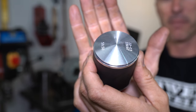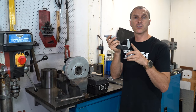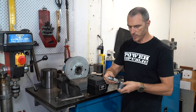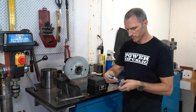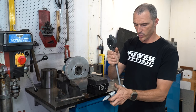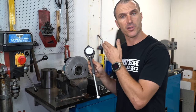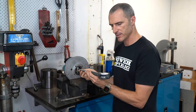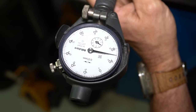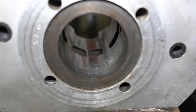The brand new piston is ready to rock and roll. We're going to measure it using the outside micrometer — you can buy a cheap one online, it'll probably do the same job as a fancy one. Just want to measure your piston carefully. Then you can set the bore gauge to the size of the piston and check your clearance. This one's got 14 hundredths of clearance which is going to be perfect for this old school high-revving machine. So all we need to do is a little bit of a clean up in this cylinder and we're ready to start assembling.